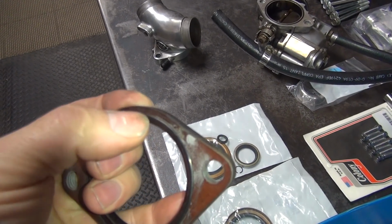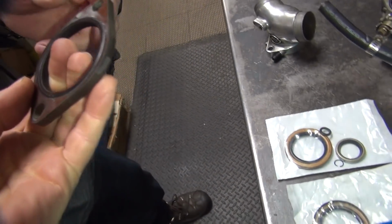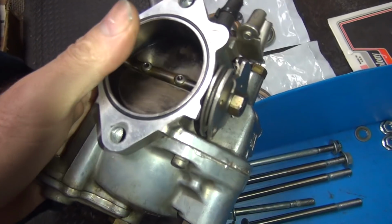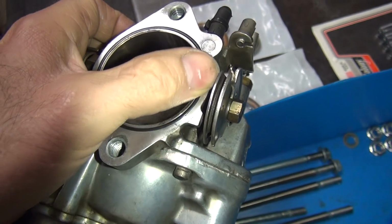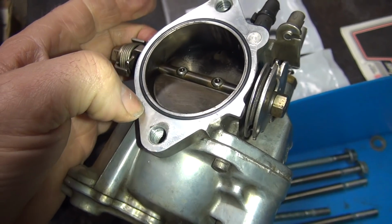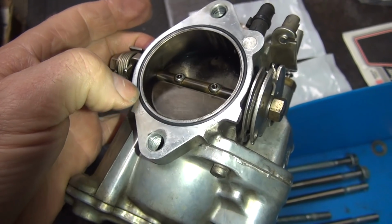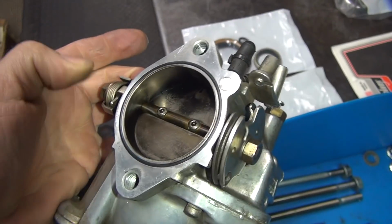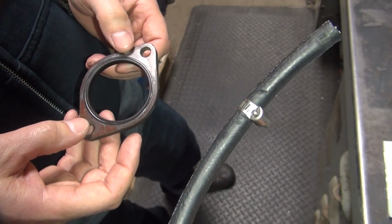See over here it's a little bit thinner, but it's still round. Feel it? Mm-hmm. And you also got another one on the carburetor for the other half. That's the same thing. You look at it, make sure it's smooth and above the surface. And then you can press on it, you feel it soft and malleable. So these are both fairly new rings, it feels like.